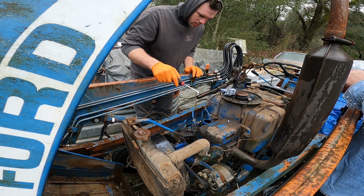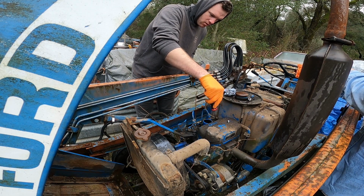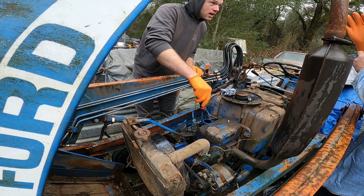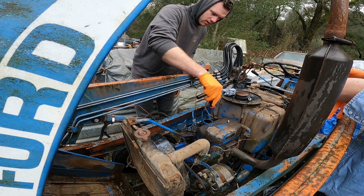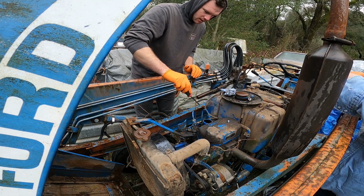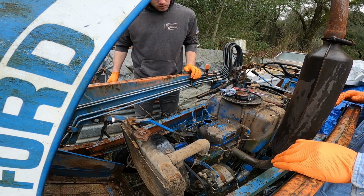You know what we're going to have to do? We're going to have to pop these glow plugs out and then crank it, because there's no way we're going to get all that oil out of that intake so we don't hydrolock it. Okay. And it's going to do the old aortic. Exactly. Aortic aneurysm? Precisely.